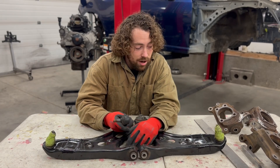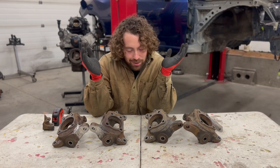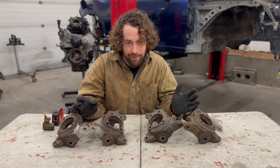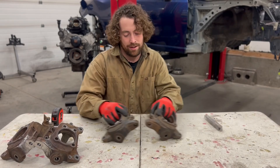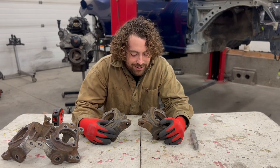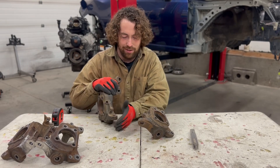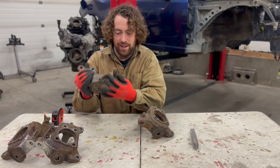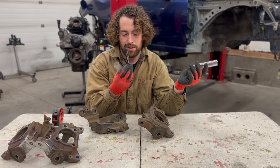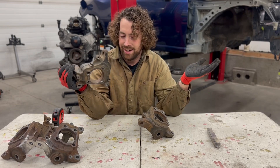Now for knuckles — if you want to make some knuckles for your car without spending big money on an angle kit, and you're handy with tools, I'll walk you through my two styles of modded knuckles and the benefits and drawbacks of each. First up are the re-drilled knuckles. Back when I was running a stock power car or even my turbo setup with around 280 horsepower, these were great. They're very easy to make — you just cut off the old tie rod pickup, thin out the metal, and re-drill it with a seven-degree automotive tapered reamer. I'll include measurements.